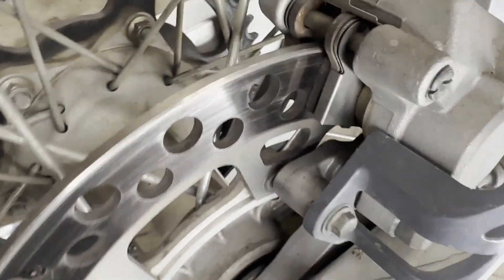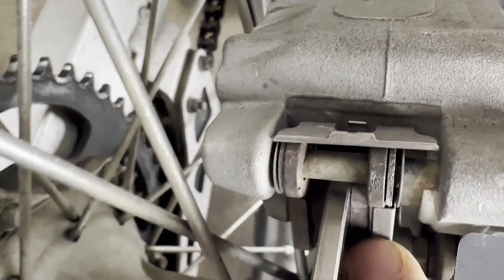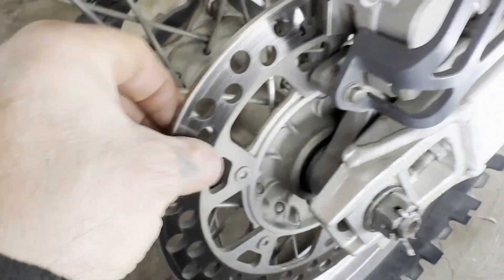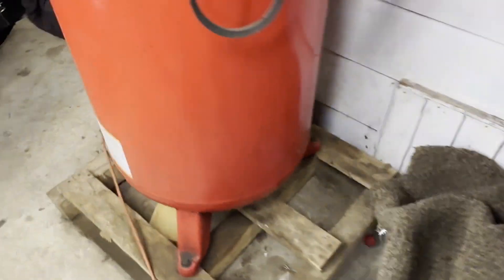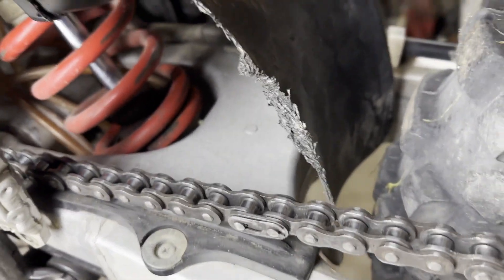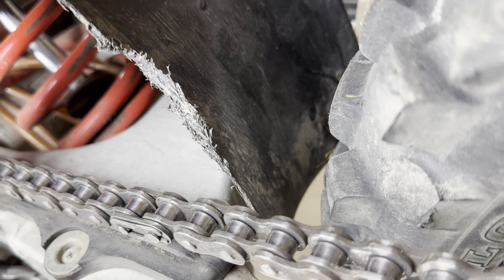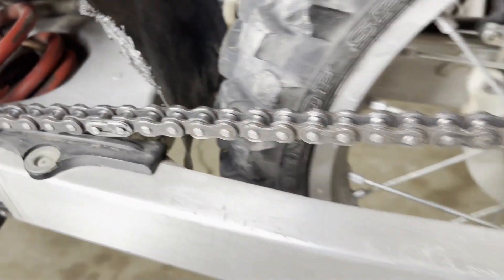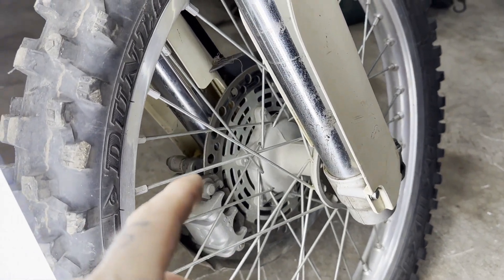The rear wheel is dangerous. Check your brakes — see if there's any pad in between. Looks like there's plenty of pad and no grooves. The rear tire looks good here, but if you come around the other side you'll notice the chain was loose, or the wheel — it's been hitting there. So that's a good indicator that something hasn't been right back here for a while.